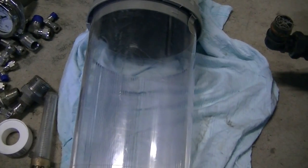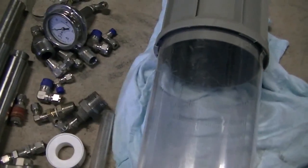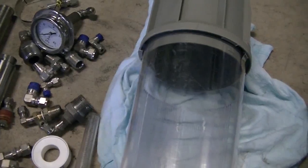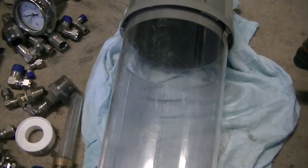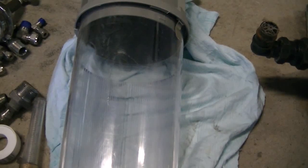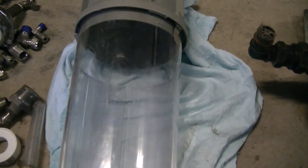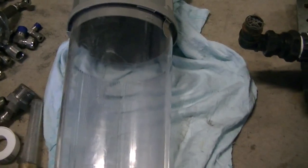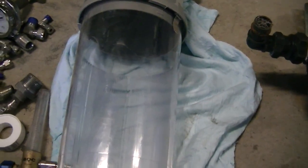Here we have the container that's going to hold our cell. It will hold about 25 psi, which is much more than we need. I see a lot of guys pumping up the pressure on HHO systems and I have no idea why - you're simply relieving that pressure as soon as you're putting it into the carby. The only thing you do by pressurizing a unit is create a bigger explosion if you should get a burn back in the system. So we will be only running about 5 kPa - 1 to 2 psi maybe - and that will be all that is required.